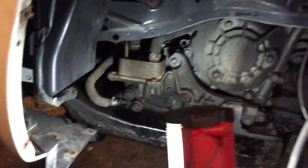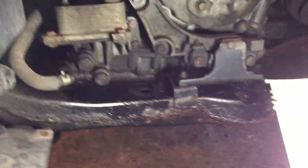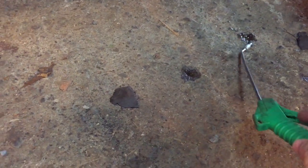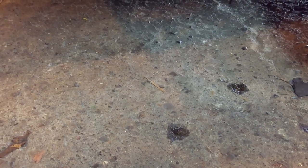I've removed the shrouds underneath the wheel well, which exposes the area in question. You can see this drop right here and this drop back here — this is what I was seeing underneath the car at parking stops. I was checking the transmission fluid; at first I didn't see any real difference and didn't think I was losing any, but then after a couple of weeks I definitely lost some.